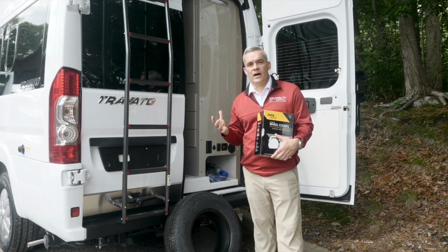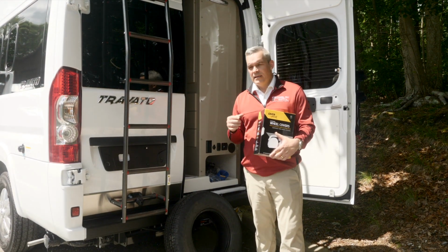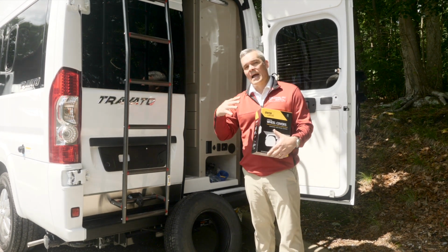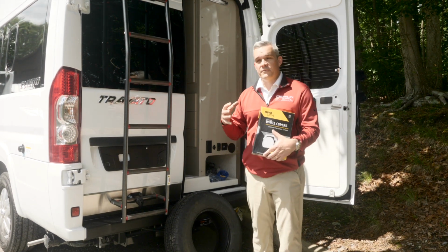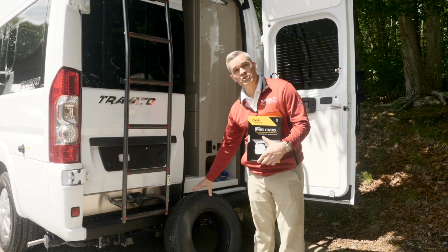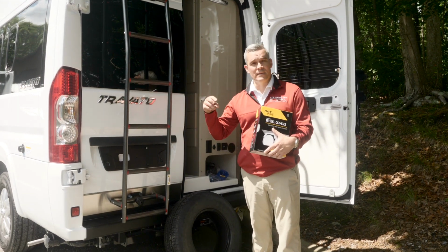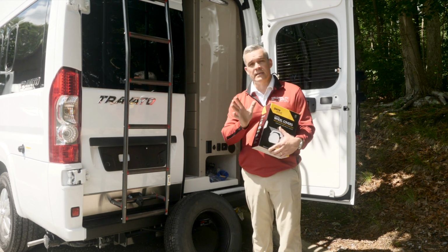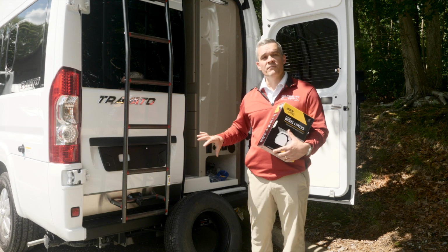So if we have two different tires, one that's driven and one that's not, what's going to happen differently is, for a tire that's driven, as the tire is flexing and driving down the road, it's going to have its own natural waxes coming to the outside of the tire, and that's a process called blooming. It's going to protect the tire, the sidewalls, and all of the rubber portion from UV and ozone. As opposed to a tire that's in storage and not driven and is out in the elements, in the heat, wind, and sun, that's not going to have its natural waxes continuously moving to the outside of the tire and protecting it. So it's going to speed up the breakdown of the rubber.